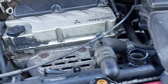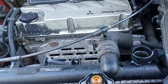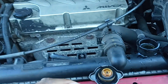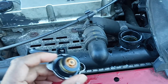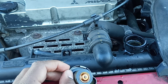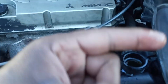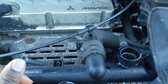Good day drivers. Today I'm going to show you how to drain your antifreeze from your car. It's usually the same thing on any car, though some are set up differently. Right now I have a 2006 Mitsubishi Outlander. The reason I'm draining my antifreeze is because it gets dark — usually it's just time to be drained. You can drain the antifreeze every year; check it, and if it's dark, drain it and put new antifreeze in.